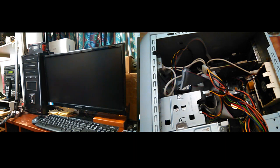I don't believe we're going to get any video unless there's some kind of error, like I don't have a PS2 keyboard or mouse plugged into it. But did it beep? Wasn't paying any attention this time. Turn it off. It didn't go off. Okay, you got a little slower. See if it does a beep. Yeah, it's not doing a beep anymore, and it was at first. So, it's always a possibility that without a USB mouse and keyboard, it won't act right. I just have my USB plugged in from my... usually you're going to get something on the screen, though. Huh. Well, the video card is the thing that looks like it could be something wrong.